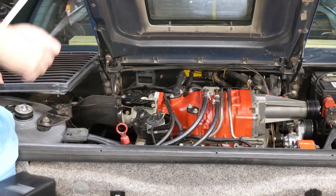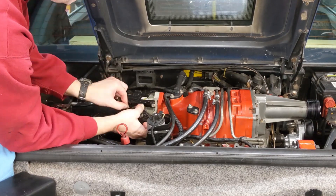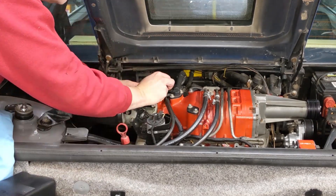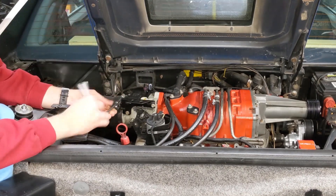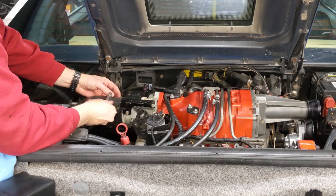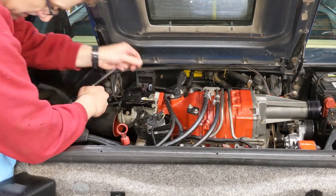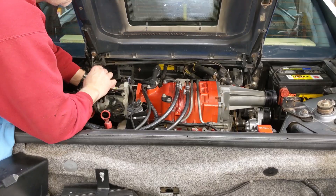First up, let's remove the grill from the driver's side. Then I'll go ahead and remove the throttle cable and get that out of the way. Next, remove the wires for the throttle position sensor, idle air control valve, and mass airflow sensor. And then we'll go ahead and remove the cold air intake tubing from the throttle body. Really, all we have are three nuts that hold the throttle body to the supercharger, and we can pull it out of the way.